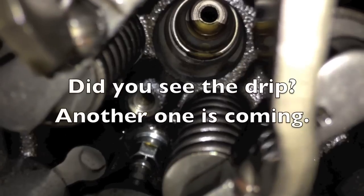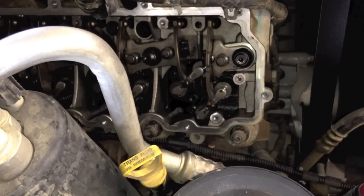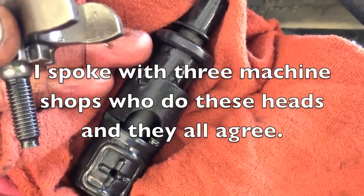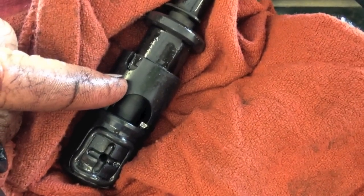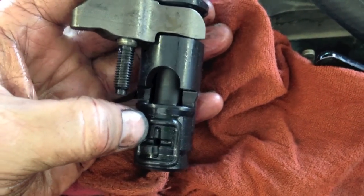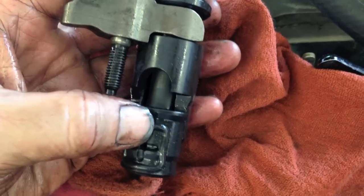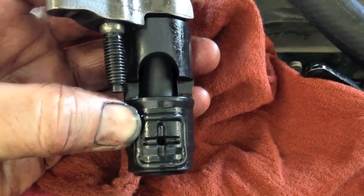This is number five - the one that's cracked, it has the problem. Here's another clue about where to look and what to look for. We take the injector hold-down tool - that's how we're going to inject the Bulletproof solution. This is the tool made to inject it into the cracks; it indexes just like an injector would. All of the evidence is focused around the six o'clock area on the injector bore. That's the common area where they crack, and that's exactly where we found it.